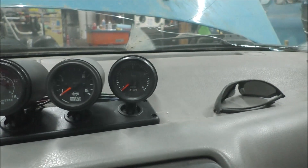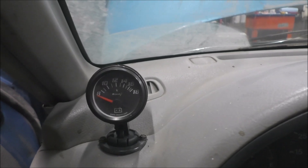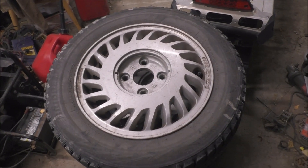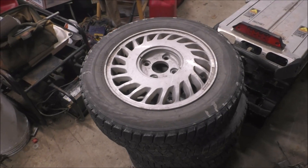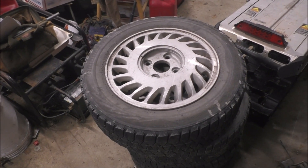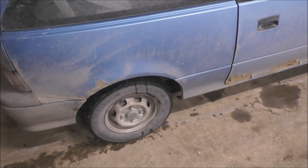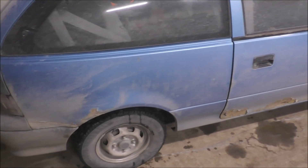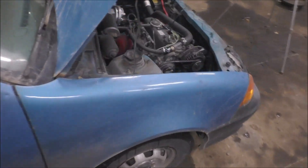Eventually I plan to put a turbo on it. Got the tach gauge right there, and just volts over here. When I first got it I had a lot of charging issues, so I put in the voltage gauge — because by the time your battery light comes on, the voltage is already so low you're kind of screwed anyway. When I first put the diesel in it I had these Honda 15-inch wheels with 185/65-15s. Running them with the gas engine, hills were definitely a lot worse but it didn't seem to affect mileage much — still getting about 40 miles a gallon. After running a couple of tanks with the Kubota and getting about 40 miles a gallon, it just seemed like it was working hard watching the exhaust temperature. So I went ahead and put the stock size ones back on and now I'm getting 50 miles a gallon.